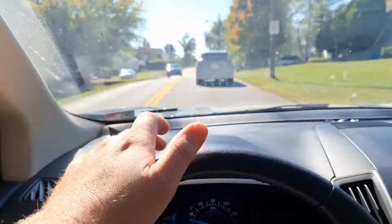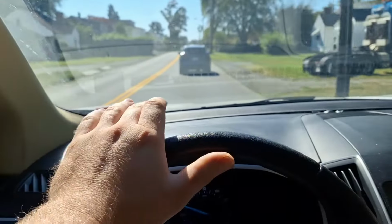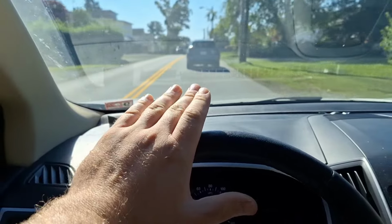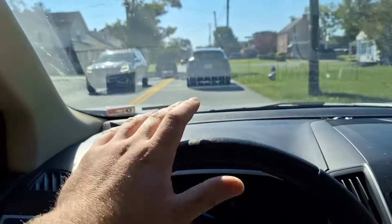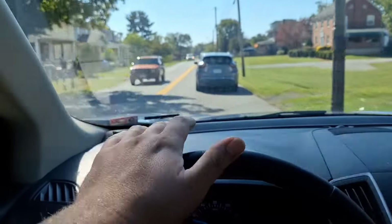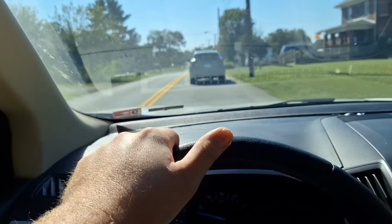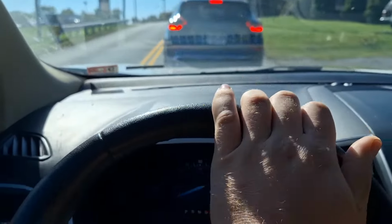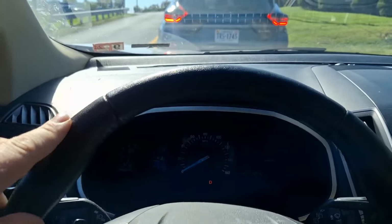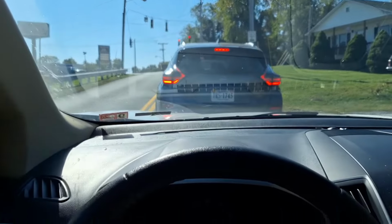it's going to be an issue with a clutch pack or a band or whatever your transmission has inside. This one doesn't have bands, but the solenoid applies the clutch, and it's going to hold the clutch on, and then it's up to the clutch to stay applied. And in this case, I believe there's a hard part failure or a clutch pack failure. Well, ooh, did you see that? Did you hear that? That was a hard shift. Woo, you might want to rewind that if you missed that.